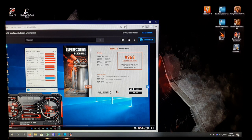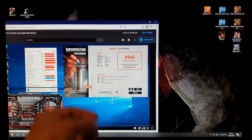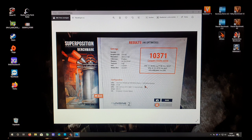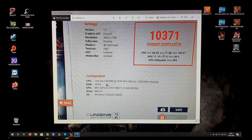I just don't want to talk badly about these people — they know what they're doing and it's really a great modification. But you guys really need to think about whether it's really necessary. If you do that, just do not apply liquid metal over the electronic parts — you're going to destroy the soldering contacts over time. Let me show you my benchmark results. This I did about two days ago with my own overclocking, and let me zoom in a little bit so you can see.